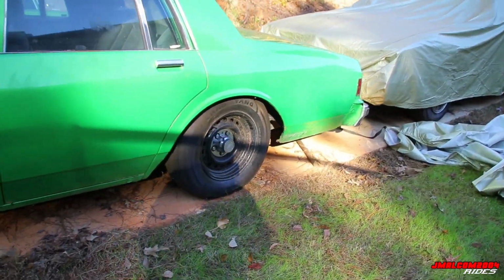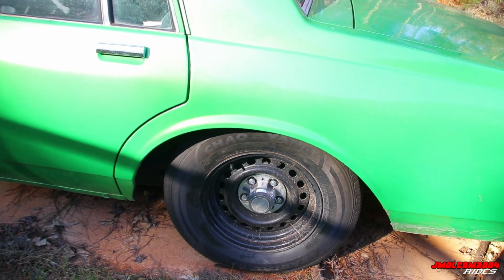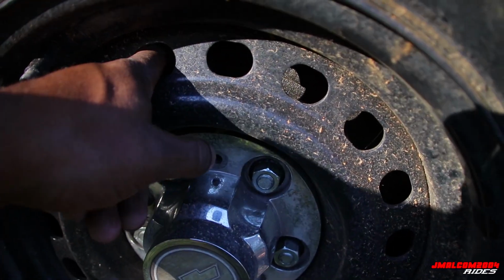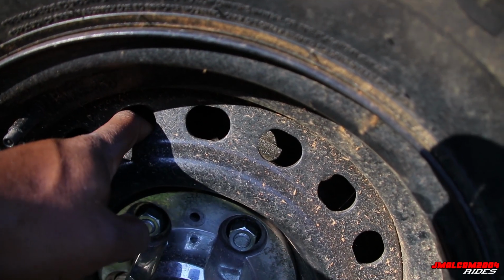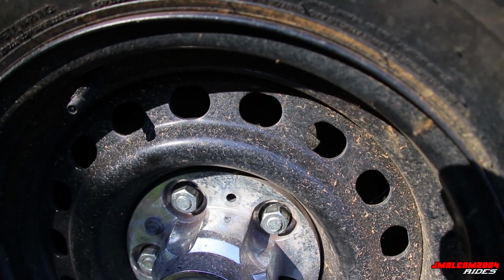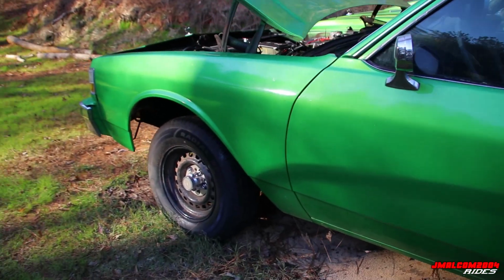And another thing you want to check on 9C1s, look back there, make sure the wheel cylinder's not leaking and all of that, cause they beat on these cars. And this is another way you can tell. You can feel through here, and you can tell. Well, I can. But the brake drum, they use bigger brakes. They use 11-inch brakes instead of a 9.5-inch drum. So they got bigger brakes on the back and all that. Check your tires, gas tank. Check all the hoses for leaks. Make sure they ain't dry rotted and all that.